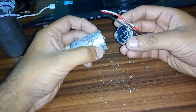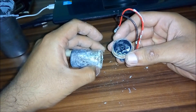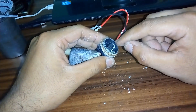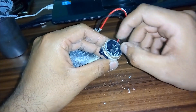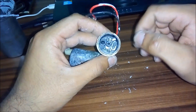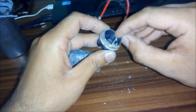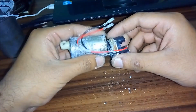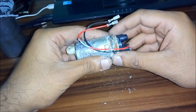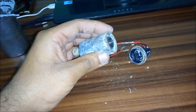Now I'm going to show you how to repair this thing. This is exactly what happened with me — the right-side carbon brush wore out, so I managed to put a larger spring behind it, obtained from a ballpoint pen. Cutting the motor is not exactly a good idea. Let me remove the armature as well to show you exactly what's inside. If you want to go this route, remember: on the black side, cut just a little bit and make sure not to cut very deep.